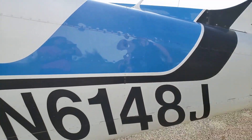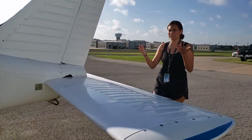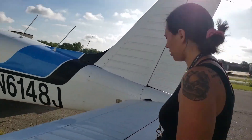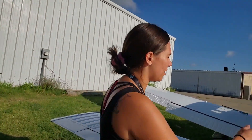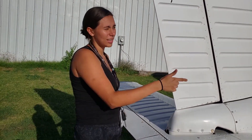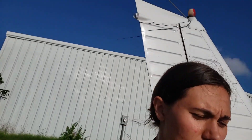And leading edge. Leading edge, I'm sorry. This is your empennage. This is your horizontal stabilizer, so your elevator — this is how you control to go up and down. There's a trim tab at the secondary elevator so it can relieve pressure. Rudder. What did you say Nicole? Rudder. It controls your nose wheel, so it's how you steer on the ground. Then it controls your yaw in the air.